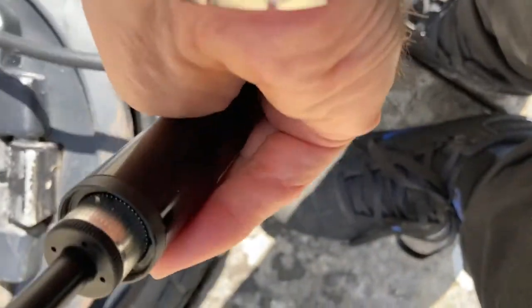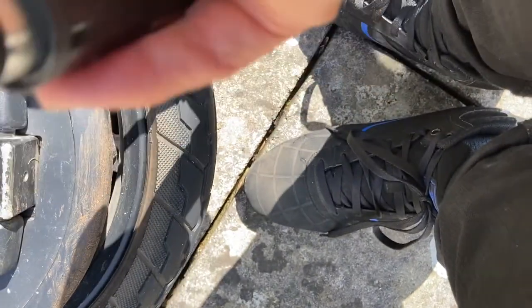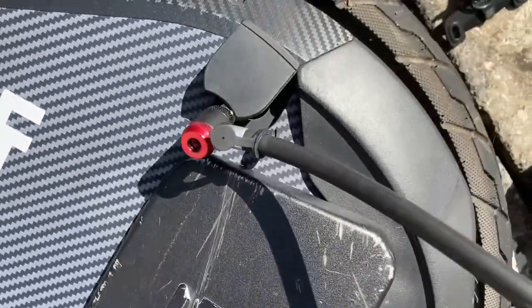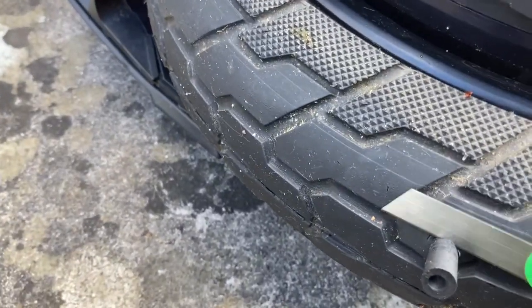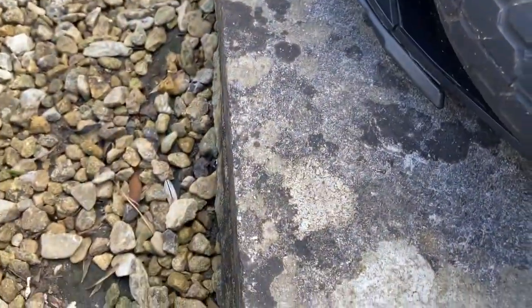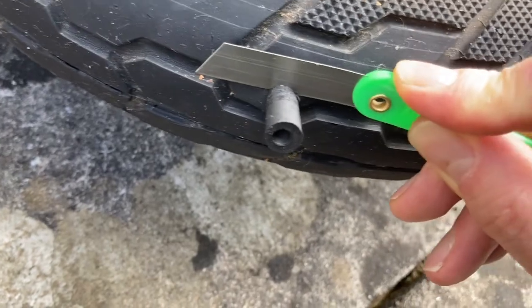As you saw there, when you pull the funnel out with the plugging tool, the plug is in position with that long tail, which you're supposed to leave in while you pump up. For this bit I was thinking, is this going to work, or am I just going to get no tyre pressure at all? But I was quite surprised, because the tyre inflated up to the 20 psi I wanted to run with. So the next stage is to chop off the tail of the plug.